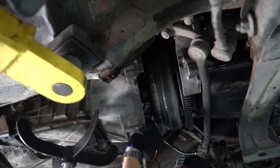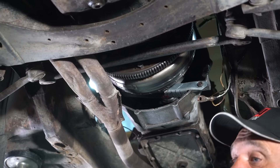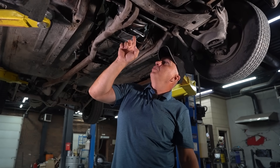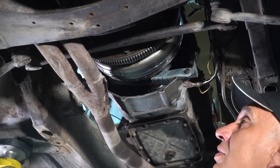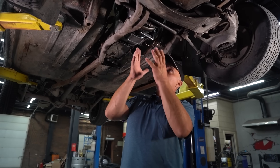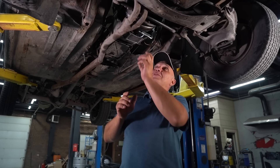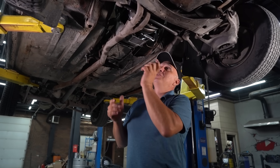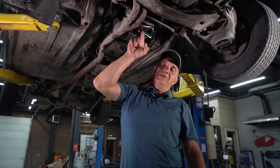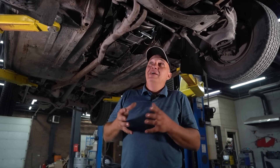So we've got it all assembled — we've mounted the gearbox, and we got the torque converter which we've bolted straight to the flywheel, as it would be. The pump is secured in place and we have not removed any of the lockup components. We've got everything mounted on studs, to be able to move the gearbox away for the starter motor to bolt up and to get a clear view. The torque converter is very wide, making it necessary to move the box away. In the converter itself we've drilled a hole, welded on a nut and stuck a bolt into it — that is essentially the filler neck.